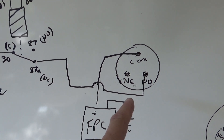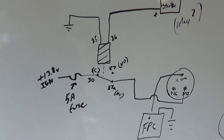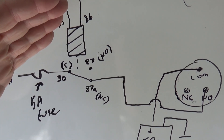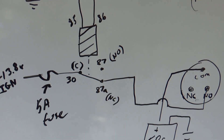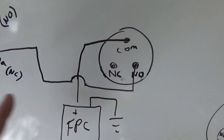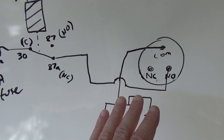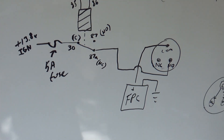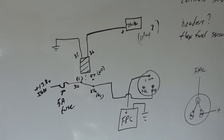At rest with no pressure, the switch is in this state - when you give it five PSI pressure it closes the switch. So at rest you've got power going to the fuel pump controller, but you really don't because there's no pressure built in the motor yet - it's open. The sequence is: you turn the key, hit the starter, the starter energizes the relay and opens the circuit, so any time the starter is turning the relay is open and won't let power through. While it's cranking, pressure is being built and the switch will swing closed - but the fuel pump controller would be on if it wasn't for the starter holding the relay open. Once pressure is built, the starter stops, de-energizes the coil, and closes the circuit - so nothing comes on until the motor is actually running.